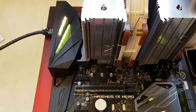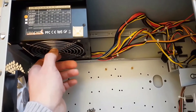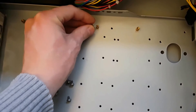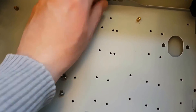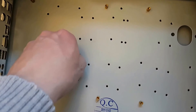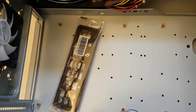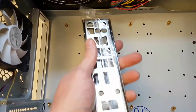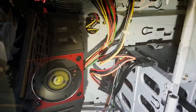Let's go ahead and put this inside the PC housing. The next step is to insert the power supply - this is not a very good one, I will replace that later. Screw in all the bolts and verify if all screws are fitting. I already verified everything is okay and now I can insert the main board. You have to insert the shielding front panel for the main board first, and then insert the main board.